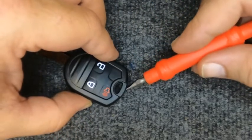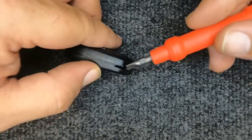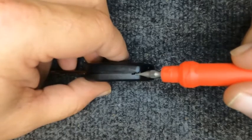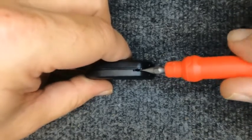If your key ring is attached, you'll want to go ahead and remove it — it gives less chance of damaging the remote and makes it a lot easier. If you follow your seam, you'll see there's an indentation that sits down farther — that's where you want to put your flat tip screwdriver in.